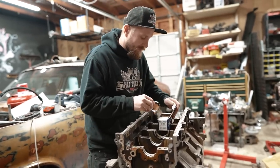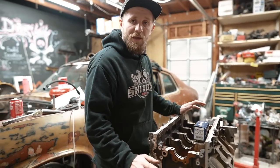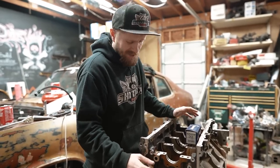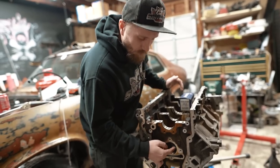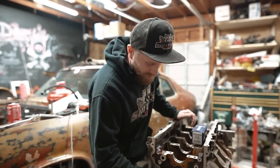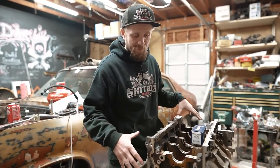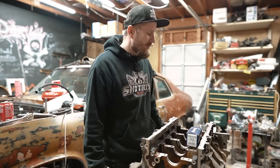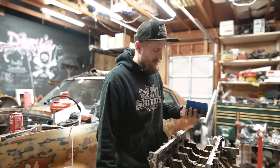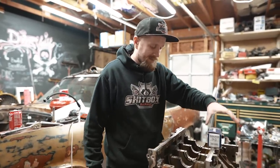Now, this is just a wild thought because I was looking at it earlier, trying to figure out how to line it up. I'm sure there's some professional engine builders that for some strange reason enjoy watching my channel. There's only one hole, but since these cam bearings have two holes, what would it be like if we matched them and drilled it out? Does the oil go all the way around? Could we drill that other side out? I don't know, I'm not gonna try it. We're not gonna be the test dummy because this is a decent motor. But if I can get the other one apart, maybe we could drill it out and see. I don't know what effect that would have, if it would be better oiling, more pressure, less pressure, how that would work. But we got a set of cam bearings.